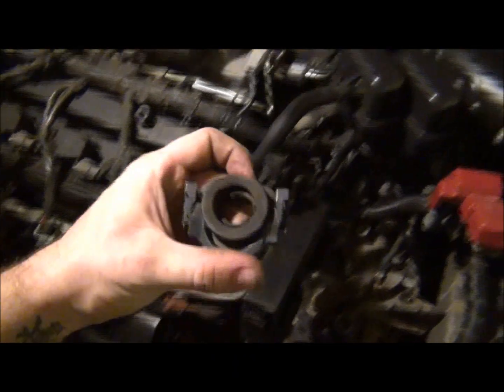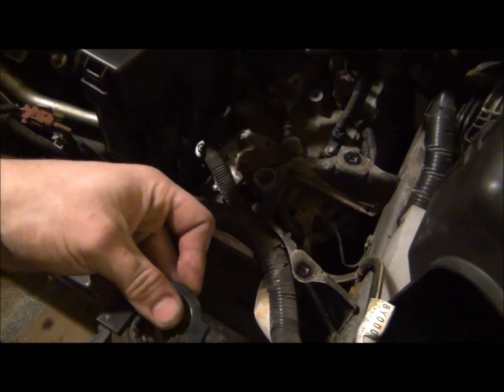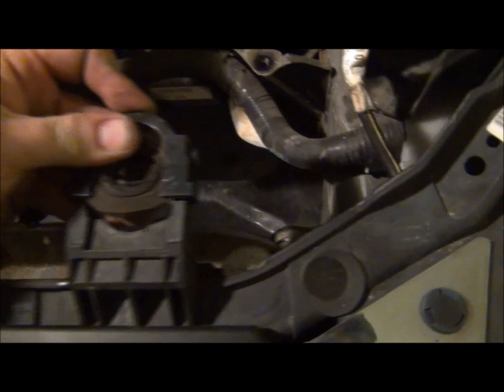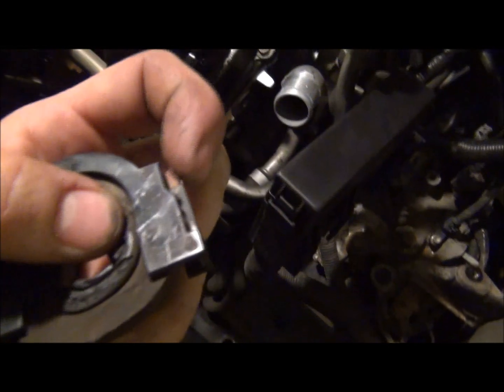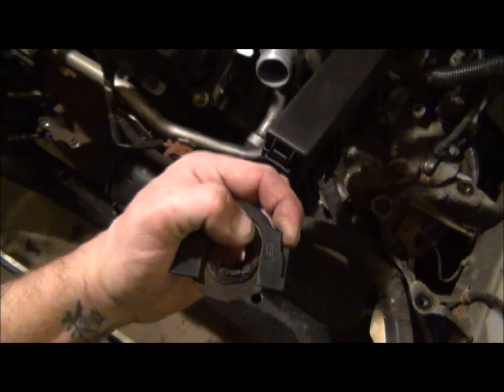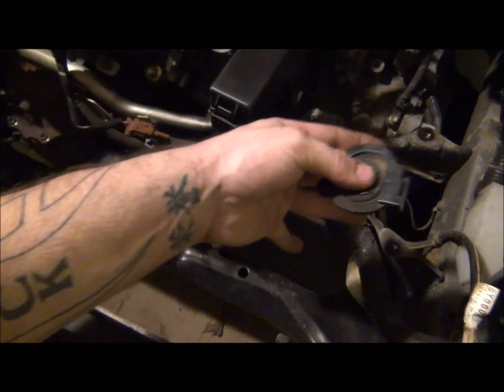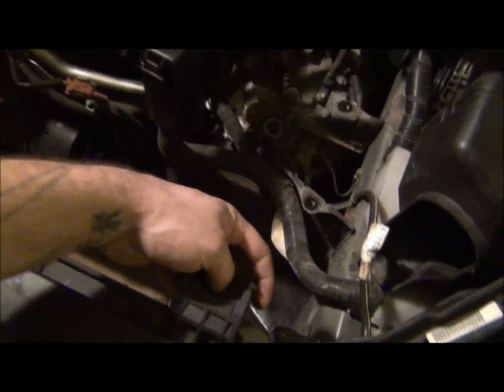Wow, really? We're gonna get it. Okay, so it was in there something like that, right? Well, these fit in here over like that. They snap all the way in. It looks like you kind of squeeze them in and pull them out. You don't. You have to take the tabs, pull the tabs out, both out that way and this way, and they slide straight out. And this bushing will sit on top of the radiator. Pull both those out, and you can pull this out.